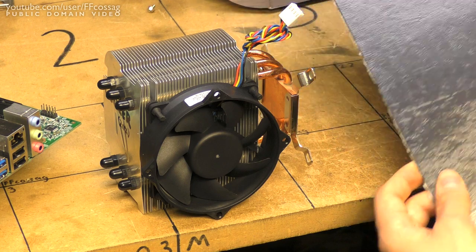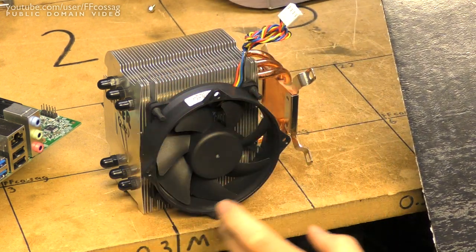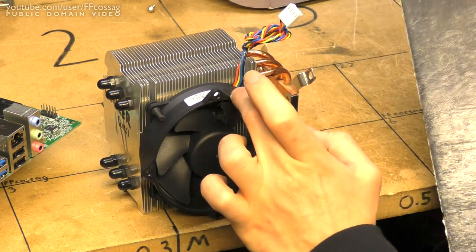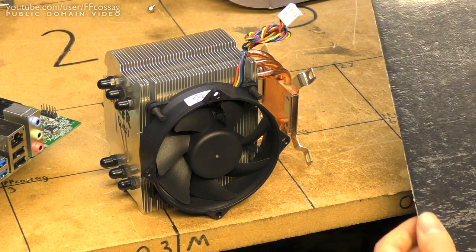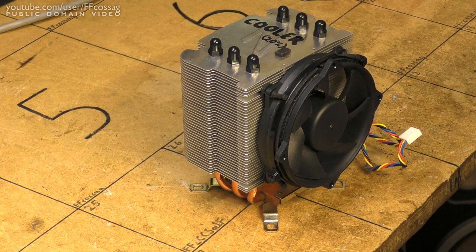So my plan now is to just cut a strip of this material and then use a zip tie to secure that around the fan, essentially pretty much quintupling the mass of the plastic frame and likely preventing it from doing much of the resonating, vibrating stuff at all. I wonder, can anyone tell that quiet computers is kind of my thing? And here's the modified fan.